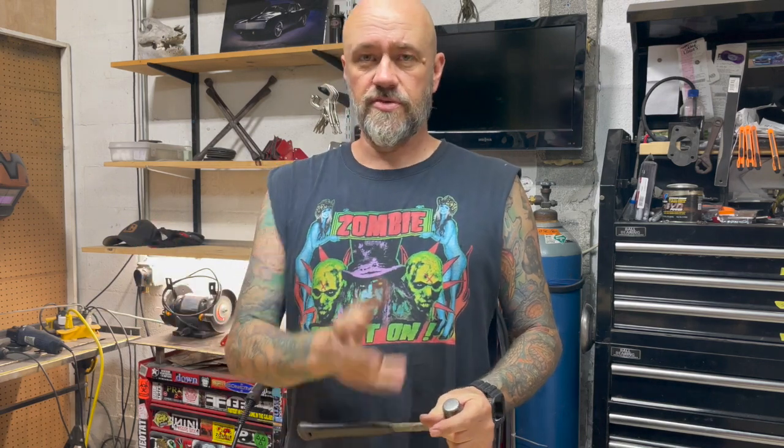So it's time to get rid of all that stuff. We're gonna take the gas pedal out. We're gonna replace it with a roller pedal. And we're going to reroute the cable through a flexible cable housing. I don't know what you call it, but whatever, we have one. And we're going to make some little mounts for it and make it a nice fluid kind of path for the cable to go in. And hopefully that'll smooth some things out.